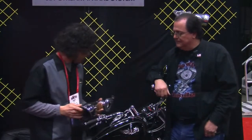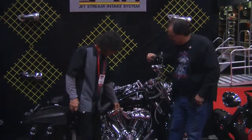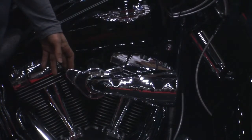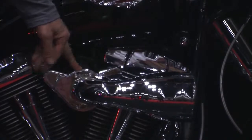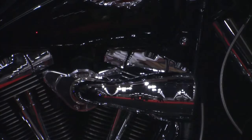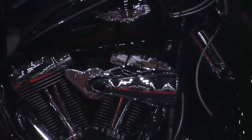But it doesn't stop there. We designed some other things into the system. Most other companies have their aluminum bracket connected directly to the bike via banjo fitting. You've got 230-degree temperature heads — aluminum on aluminum. That's heat transfer, and you've got hot air coming in going right back into your intake charge. Now you're sitting in traffic on a hot day, and your bike's not running right because it's a hot charge. There's no oxygen in that volume of air because it's hotter. And you kill your velocity when you have bigger filters on — those are the heat and velocity factors.